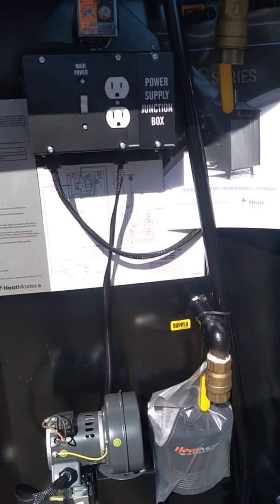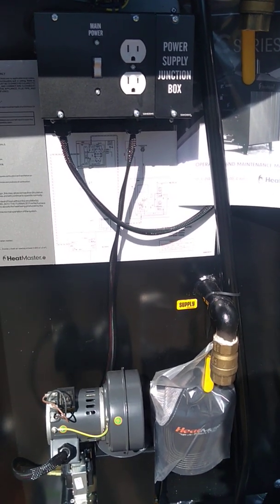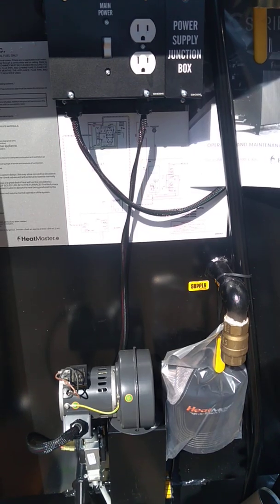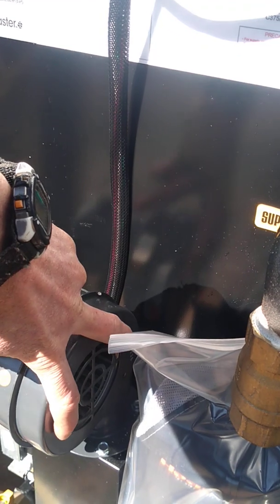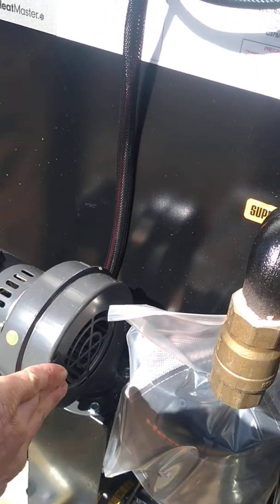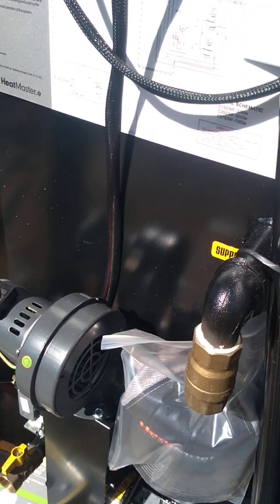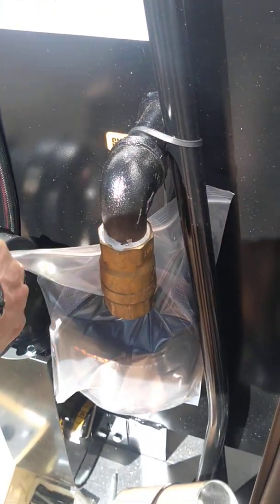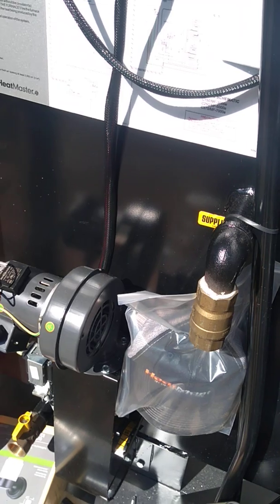On the older units that had the fan higher up with the flap landing on top of it, check that flap and make sure it's coming down tight. If you've recently replaced the fan on those older units, they had two screw heads on the intake of the fan — right here and here — and the flap would land right on top of the fan. Those screw heads would hold the flap up, so you'd need to remove the screws. There was also a ring on that fan that you'd have to silicone down to keep it in place.